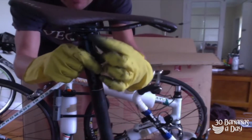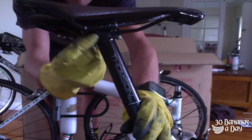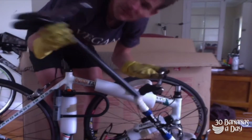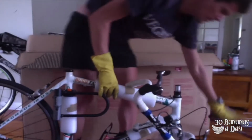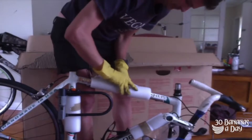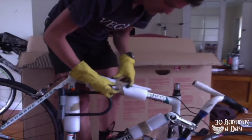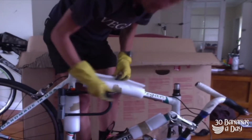There's a front wheel and a seat post in here. See that liquid paper pen mark — that white-out mark? That means when I put my seat back in the frame, I can put it right where that reference point is. You can also see the white-out mark on the seat angle as well — mark the angle on both sides. If anything slips when you put your bolt back together, you've always got a reference point. That's a big tip.